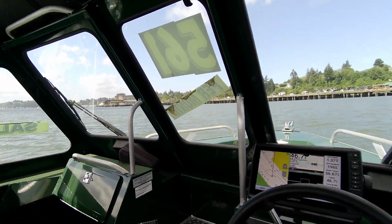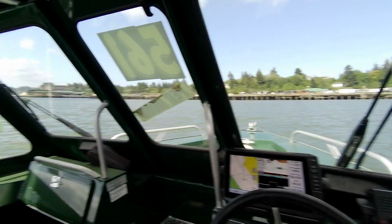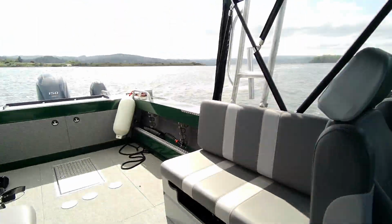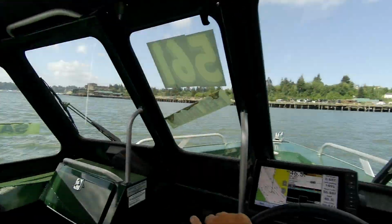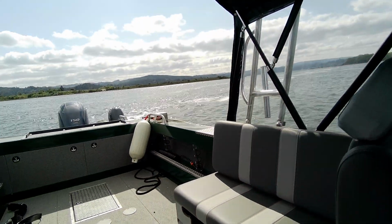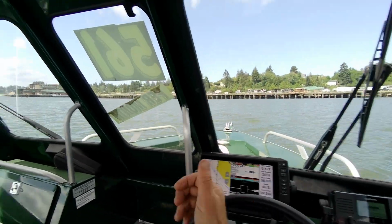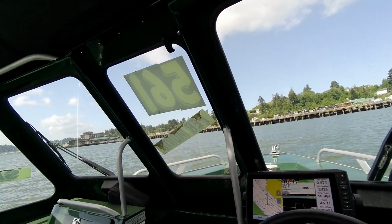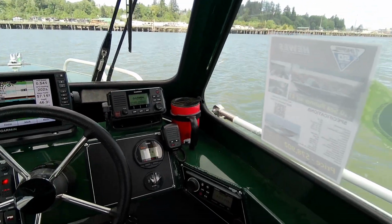So you're off on your lock to lock. So that means it won't steer. See, that should steer more to the right. Same thing here as if you center it. You can just go like this. There's 1. Now 1 1/4, right? Then you go back to the right. There's 1. There's 1 1/2. So you're off about a half turn. Okay, so that works good.